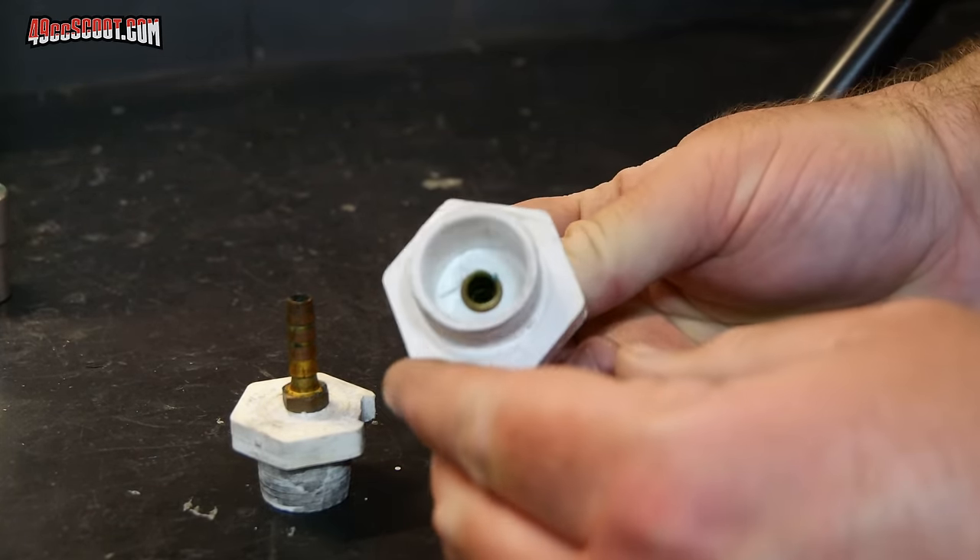At this point, being liquid-cooled, I'm suspicious of the head gasket seal — or in my case it's not a gasket but sealant — the seal from the head and cylinder mating surface. The other thing I'm suspicious of is my gauge, because I recently replaced it and I've seen it do some funky things. It may be a case of buying the cheapest gauge I could get. So I'm going to do a test to find out if my gauge is leaking. I've removed the intake adapter and replaced it with a brass rod that fits in this quarter-inch hose to block it off. That will allow me to test the rig itself without anything else.